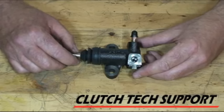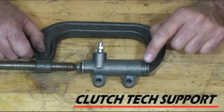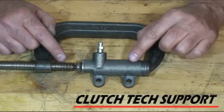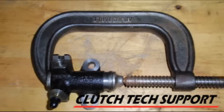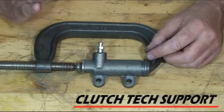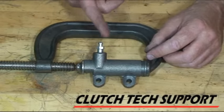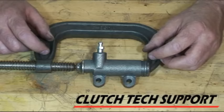So how do we change this and make it more effective? If your slave cylinder allowed you to clamp across it safely and effectively and block the piston from extending — possibly put a small socket inside there to push it down in there a little bit — with the line connected, now push on the pedal with moderate pressure, just enough to get some pressure on the system. Don't pump it, just push. Now with it blocked, open the bleed screw. Now the pedal that was being held down a little bit goes down further to the floor and you get a real flushing action from the master. It changes the system dynamics dramatically.